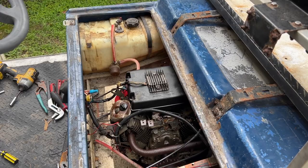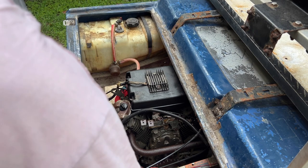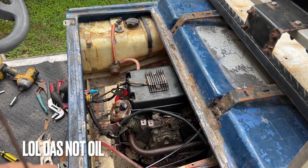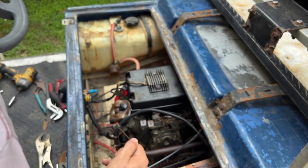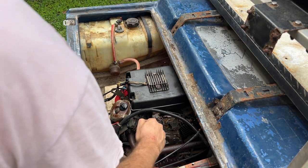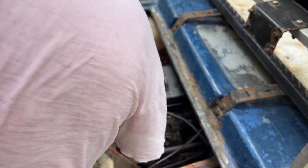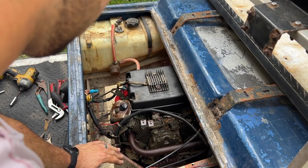She locked up. I mean, the other option is we can just try and charge the battery and see if it holds a charge. I think that's our next bet, because I can't get that to spin. And I can see we do have barely some oil in there. It's not enough for me to tell whether or not it's got water in there. Oh. Uh-oh. I don't feel any, actually. That was water. Okay, so there's no oil on the dipstick. That's not good. The next move is gonna be get the battery out of here and then let's drop the oil.